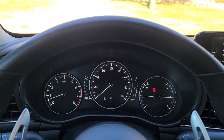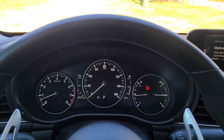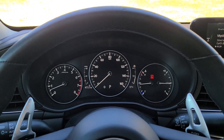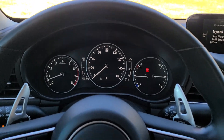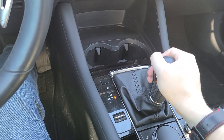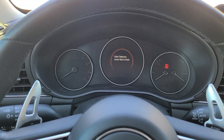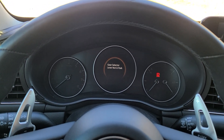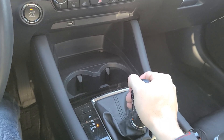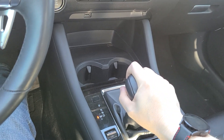To begin, the car has to be running for about 30 seconds to a minute. I've seen it fail on some vehicles that weren't at the full minute, so I always let it go to the full minute. With it on, put your foot on the brake. Go from park to neutral, then shut the car off. Then take the shifter, move it down, and hold it for five seconds in manual downshift — it has to be in that position for at least five seconds.